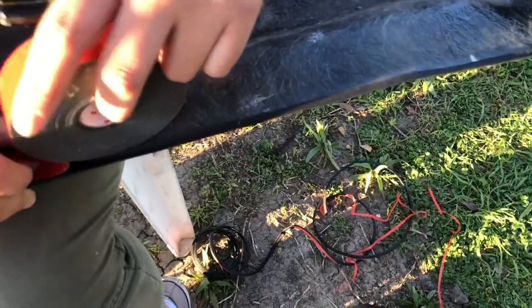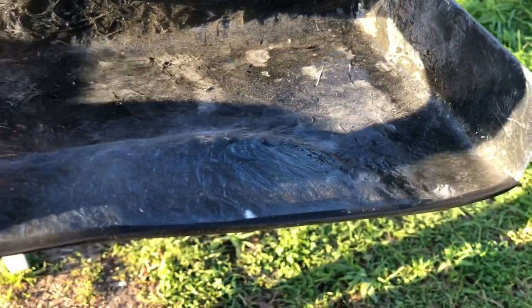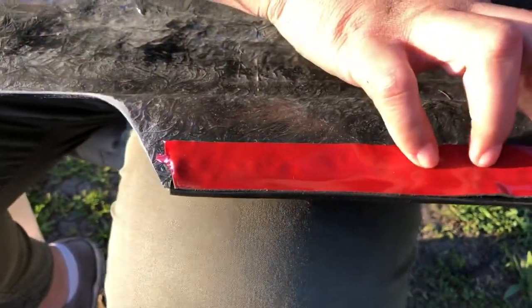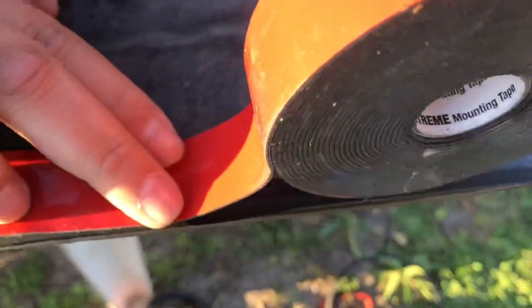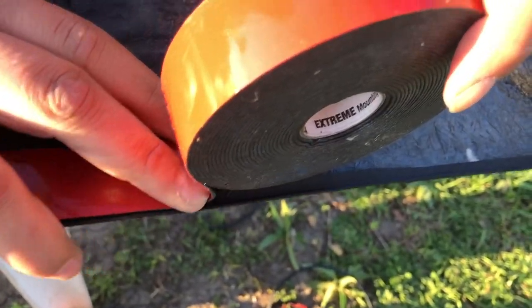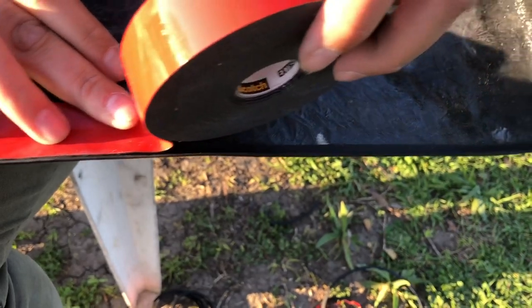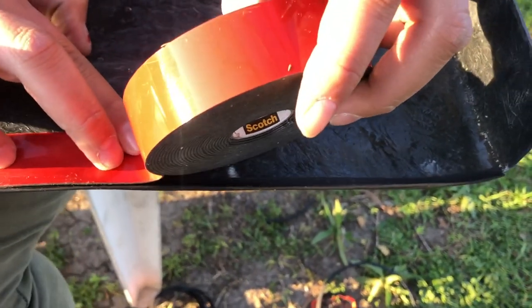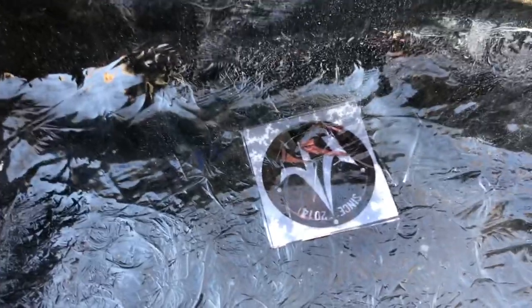For this part my lovely assistant here is applying the edge protector for the paint, so it doesn't rub on the original paint in case she decides to take it off in the future and change side skirts. She's also applying the 3M double-sided tape on top of the actual spoiler protector, as Toyota calls it. We got this extreme mounting tape from Home Depot - I forgot how much the roll cost but it was upwards of ten dollars, so be prepared to spend that much. King Fiber since 2014.